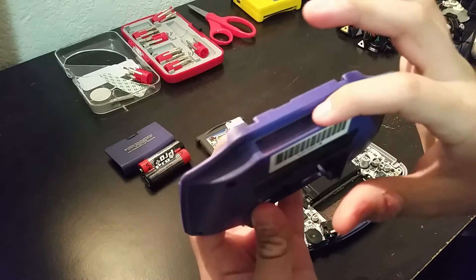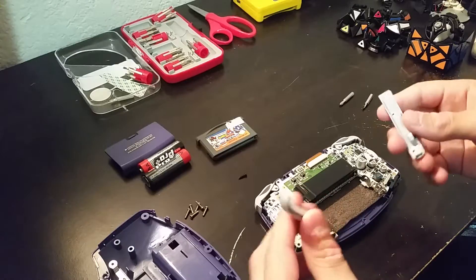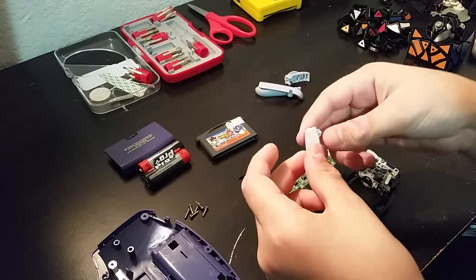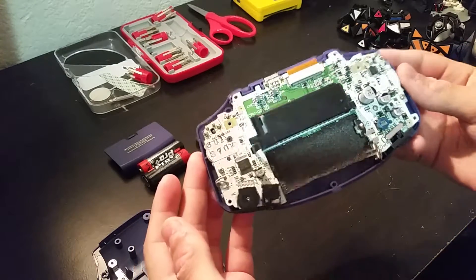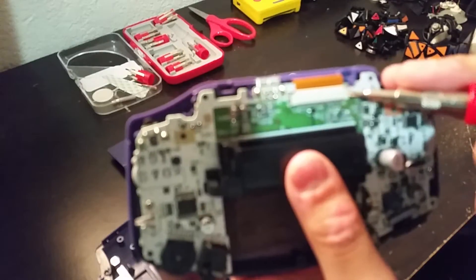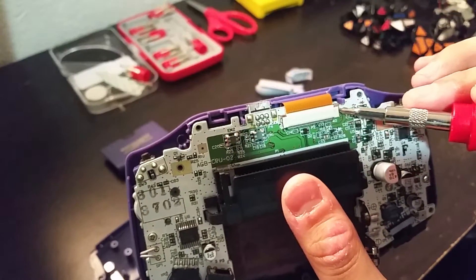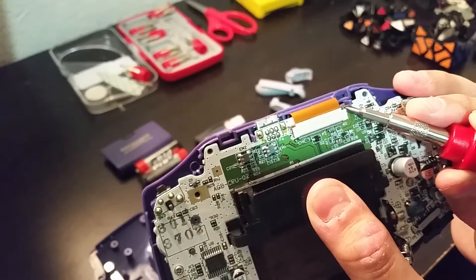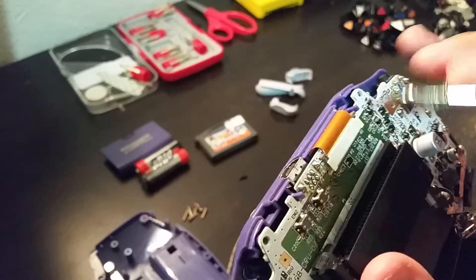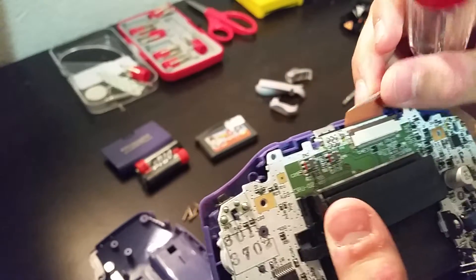There's this little shield thing for the cartridge. You can take these little grip pieces off, and you can also take off the little things with the trigger buttons. Here's the board from the back side. Just go ahead and unplug that screen connector — there are these two little gray things that you want to lift up, just push them up a little bit. Then once you have that taken out, just pull it up. This connector is for the screen too.